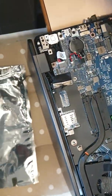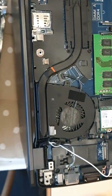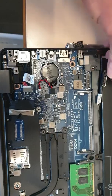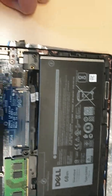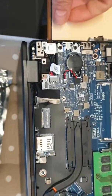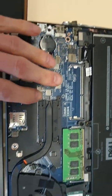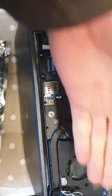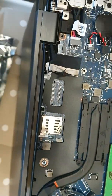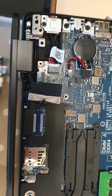Whatever you're going to do on the laptop, you should unplug the battery. This is the main fix as well — if your laptop is dead and you can't turn it on, it's doing nothing. It usually happens when you work on it and short something, with the battery plugged in. It can also happen from outside debris — a little bit of metal or hair — shorting something.